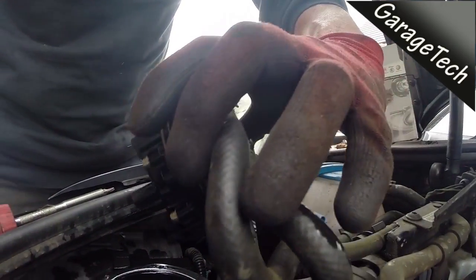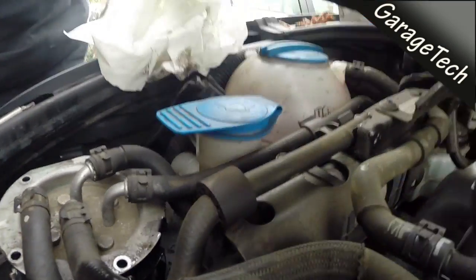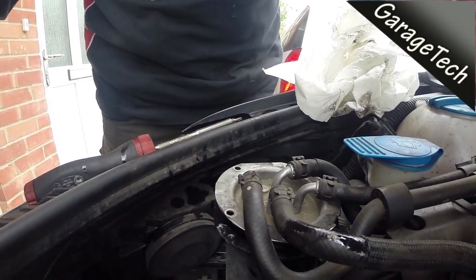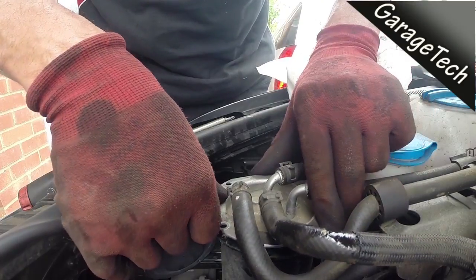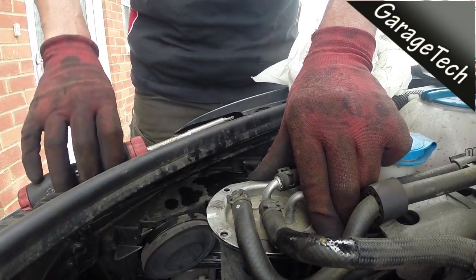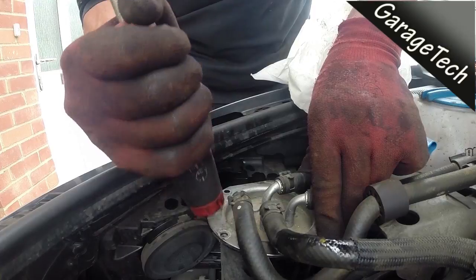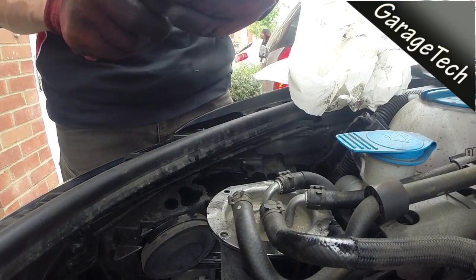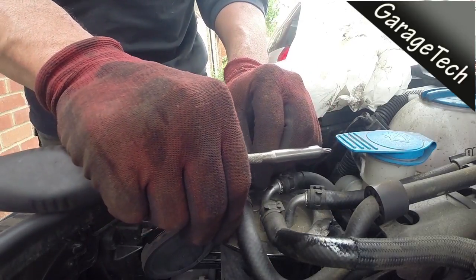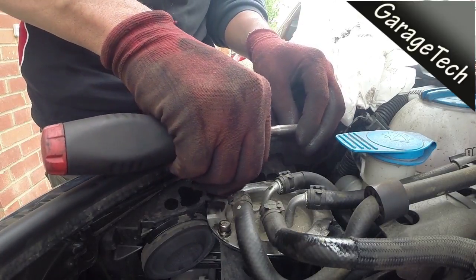What I'll make sure I do is just give it a nice little coating of diesel fuel around the seal to help lubricate it as I push the lid back on. I'll just push this down — it might be a little bit stiff. Just be really careful at this point that the seal doesn't get caught, as these are quite prone to leaking after replacing the fuel filter, so just be sure that the seal is fitted correctly.